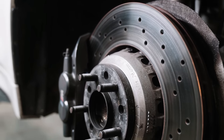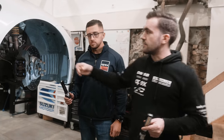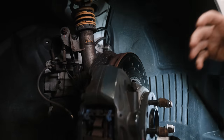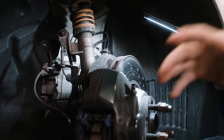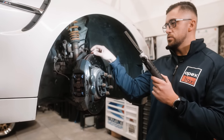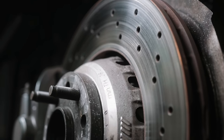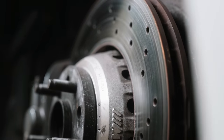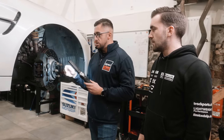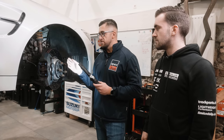You have different types of discs. If you're on an old school car with a thin disc, your overall disc thickness matters. If you want your discs to last longer, you go for a thicker disc — with calipers to allow it. A thicker disc means the material lasts longer and more material can dissipate the heat, giving better overall on-track performance. By thicker, you can also go bigger in size, providing more consistent and better braking force.